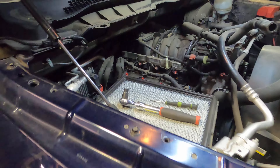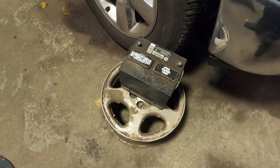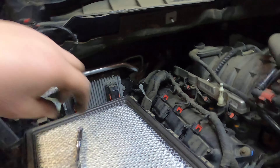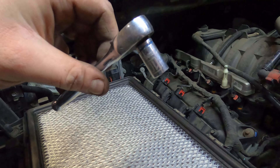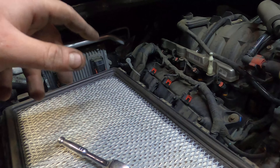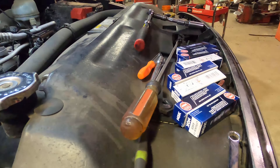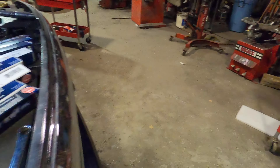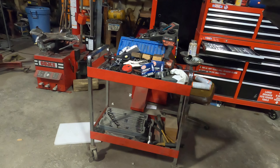That's great - and what's not great OSHA approval is the thing I made to stand on. It's a rim with a battery on it - are you serious? Cool. So the passenger side is done. For that back one, after I disconnected the hoses, I ended up using a small 10mm with a small ratchet to get to those back two 10mm bolts and everything else. On to the next side. You do eight of them, which would be a normal car, and then you realize you have a Dodge - that's another eight waiting for you on the other side.